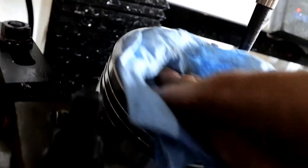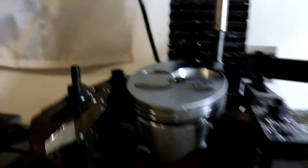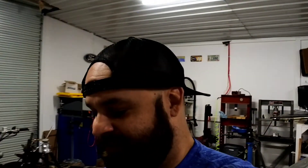That's what I'm doing, guys. We're going to pull that off the fixture — and that thing moved around a whole bunch. I was online sharing this on a small block Windsor forum on Facebook. One fellow showed me how he did it with an angled plate fixture, and I really liked it. I think I'll make that fixture so it's repeatable and I have way less chance of trashing a piston. But I'm pumped it's working so well. I've got all the clearance I need now, and six more pistons to go. Moving right along in the right direction.